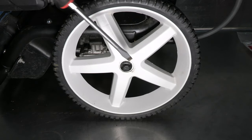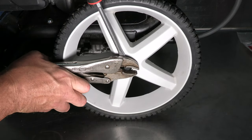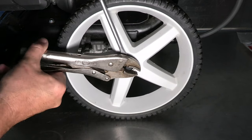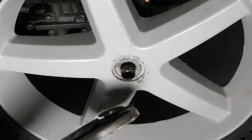Remove the vice grips and take a standard flathead screwdriver and insert it behind the flange of the cap nut. Then return the vise grips in the proper position, spanning the tabs. Work the push nut off of the axle while prying with the screwdriver in this manner.